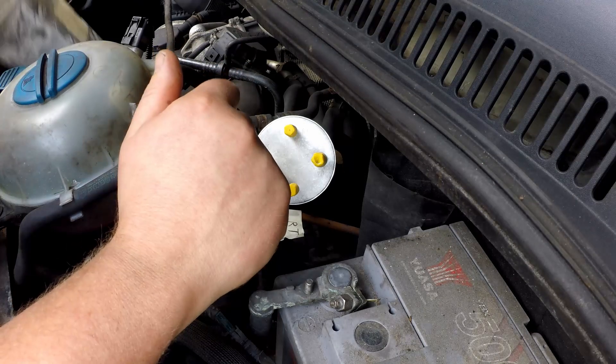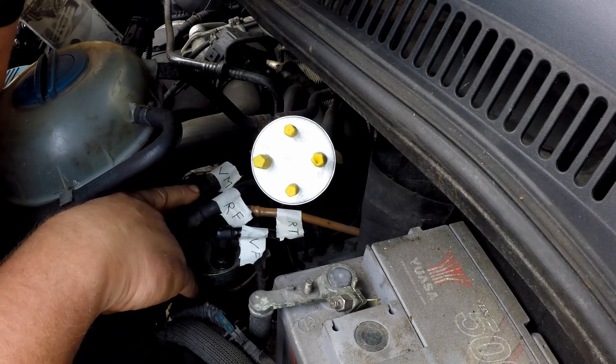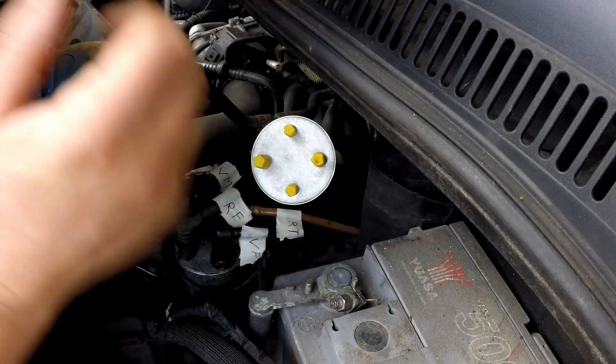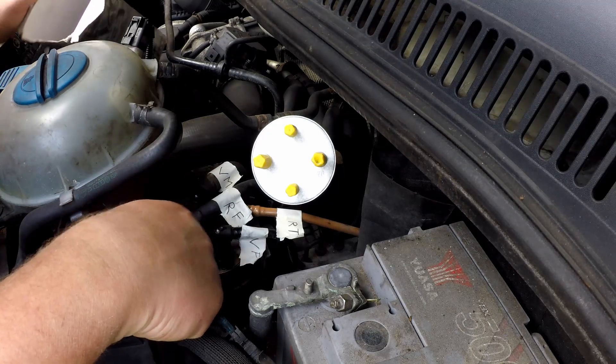To be fair, it's been running, but the fuel supply in and the fuel supply to the tandem pump is the wrong way round. So possibly that fuel filter's going to be collapsing on itself because it's flowing the wrong direction. So let's run through these.